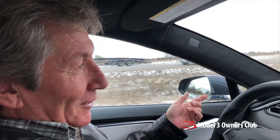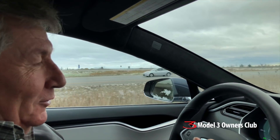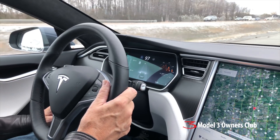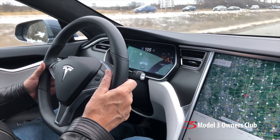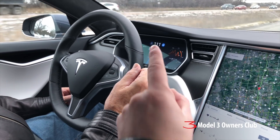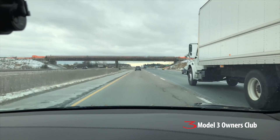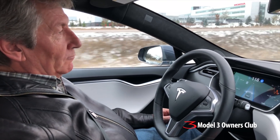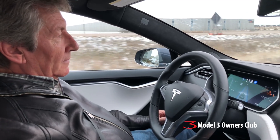Turn off your blinker once you're done — as an older man you don't want to leave your left blinker on forever. The autopilot only does one lane change at a time; once you're in the lane, it won't initiate another until you cancel the blinker and restart. Auto-steering is a separate function from cruise control. If you inadvertently cancel auto-steer, pull back on the stalk twice to activate it again. It is two different things — auto steer, shown by the blue icon, and cruise control.